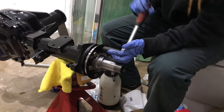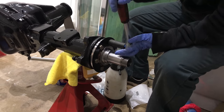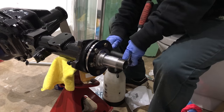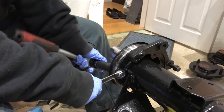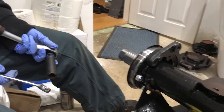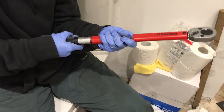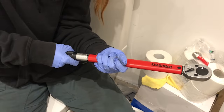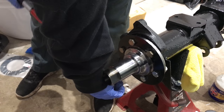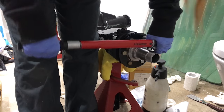Off camera I did clean the bolt holes up with a tap — the same one from a previous episode that I used to fit the diff pan. The bolts I'm nipping up currently have a nylock nut on the other side, whereas the 10.9 strength gold ones go into blind holes so there's no nut on the other side. Once all those bolts are nipped up I'm just setting my torque wrench and now I'm going to be torquing them up to the correct tension for those flange bolts.